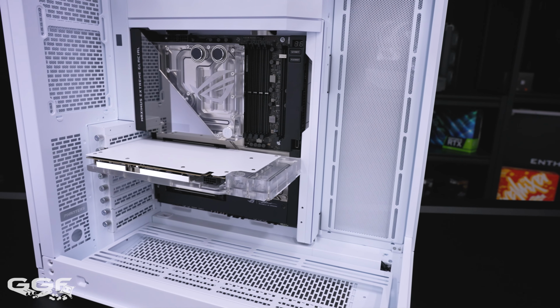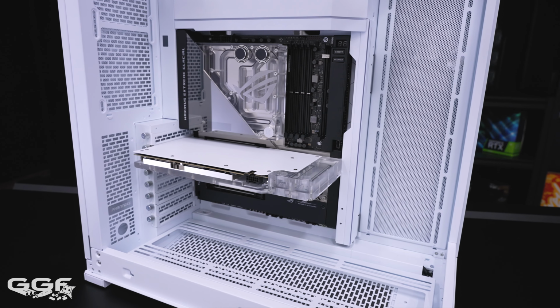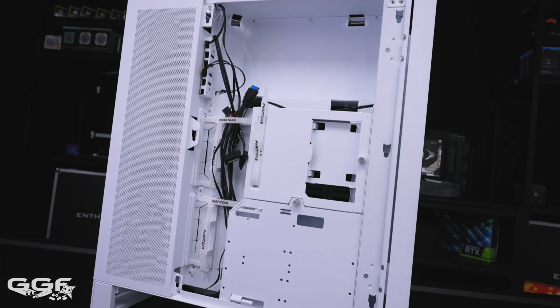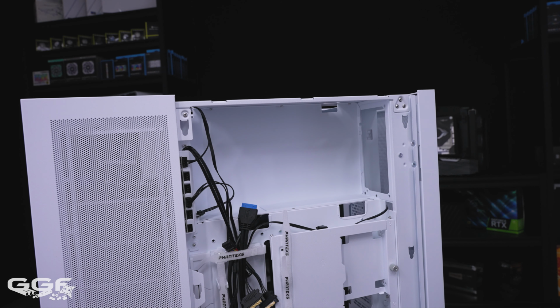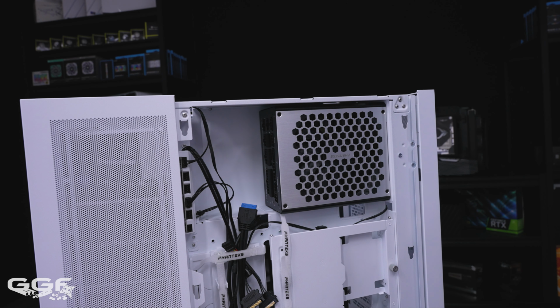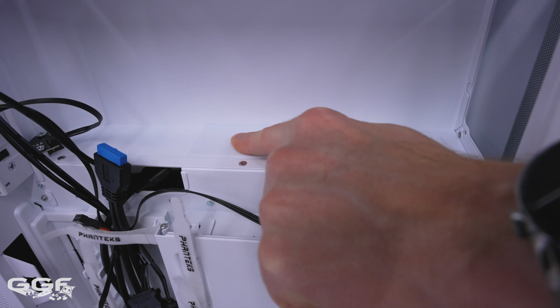If water cooling your GPU, you'll have no issues interfering with the side radiator location, as once blocked, 40 series cards become much shorter. Before we cover all the water cooling support in the NV7, let's take a look around the back, and there's a lot going on here. PSU location is now found via the top. Max PSU length, I'd say, is around 240mm before things start to get tight. There's also a foam pad for your PSU to comfortably sit on.